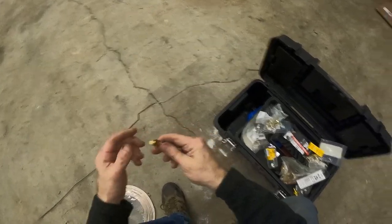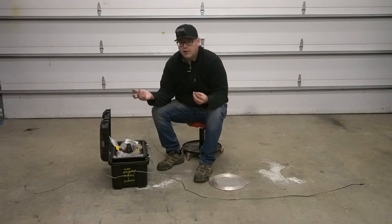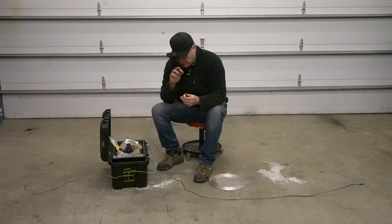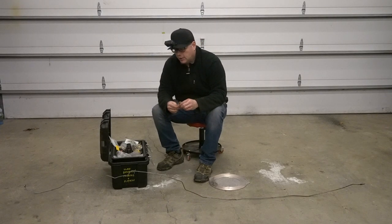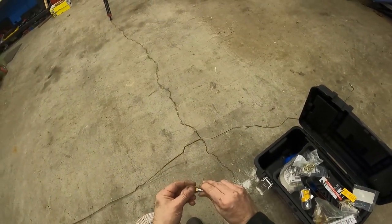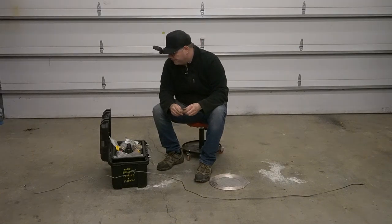When you do the lines, something very important they don't really show you: I used to be guilty of this — I would put Teflon sealing paste or tape on these fittings thinking I just don't want it to leak. Well, don't do that on a flare fitting. There's no need. If you do the flare correctly — a nice double flare — it actually seals on the flare surface, not on the threads. The threads are a clamping force, not a sealing mechanism. So on a flared fitting there's no need to Teflon up your threads.